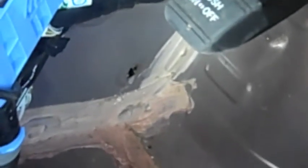I've had the hose running on the roof there for about 5-10 minutes, and that channel in there gets full of water and it starts running over through the hole there. That's where you clip the kick panel on. Now the next step is to jack the vehicle up to make access for you to get your chisel in there and your punch and your drill to drill through the top side of the rocker.